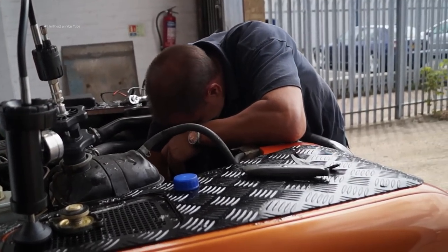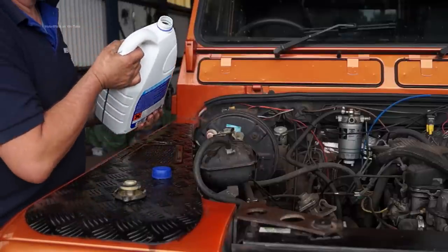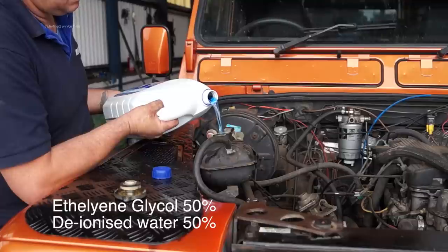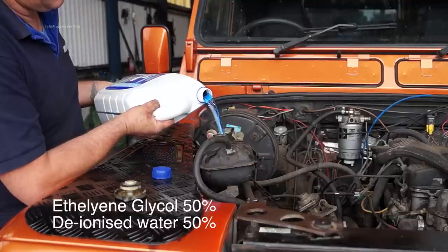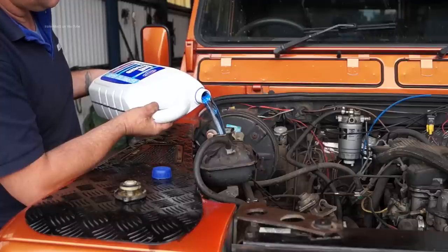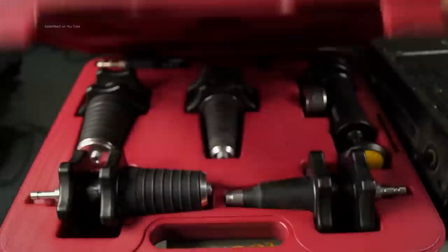Check the system to make sure it's not leaking anywhere, and then put the antifreeze in afterwards. Generally we're looking at a 50/50 mix — about five liters of blue coolant is being poured in here. Once the engine is running it will mix the water and antifreeze together.